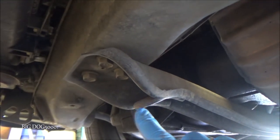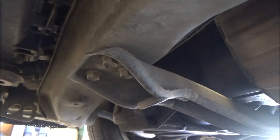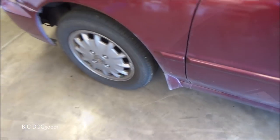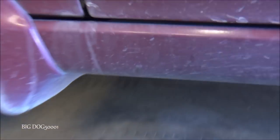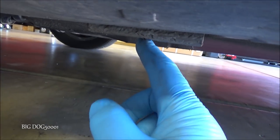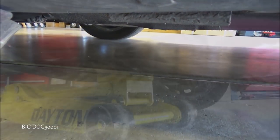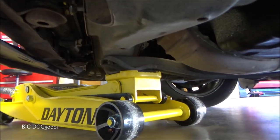There's a little bit better shot from the side — we're going to put it right across right here. Once we get it in the air, we're going to put our jack stands right on this bracket. I'm going to put one stand here and one on the other side. We are not going to get under a vehicle without jack stands. Looking underneath, you can see right where I have the jack.